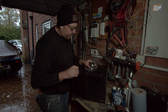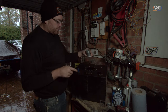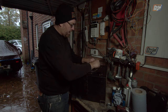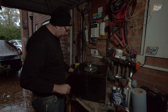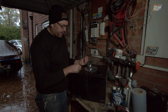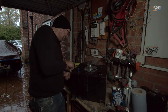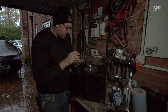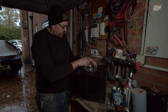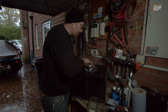All the bolts are back in. With the gasket on we can put this in, and I need to work out which way round I actually want this. The sump is on that side so this needs to go in like that, I think. This is very, very awkward. I have a small question — how am I going to run these lock nuts on without being able to hold the other side? These might actually need to be swapped out for regular non-threadlock nuts in order to get any torque on it whatsoever. Chris just suggested putting rivnuts in, which we've solved problems with before. I'm going to swap these for regular nuts for the time being and we'll be back in a second.